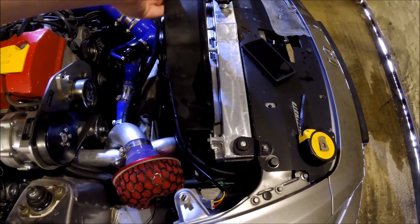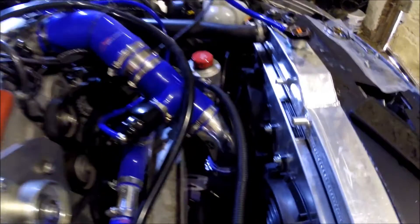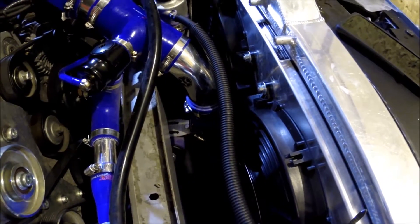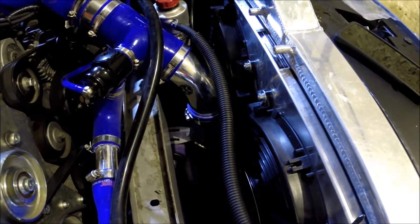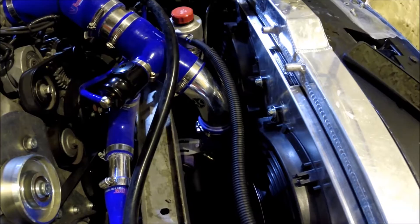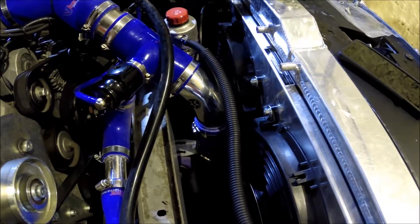I'll never get the large fan to fit in that gap, and the shroud is probably always going to be better than just having one big fan mounted directly on the radiator. What I'm planning on doing is a bit of testing - I'll put a clamp-on meter on the tails of the fan and we'll see what sort of current they pull. That'll give you a rough idea of power, because you're not going to get good airflow if you're not using a lot of amps.